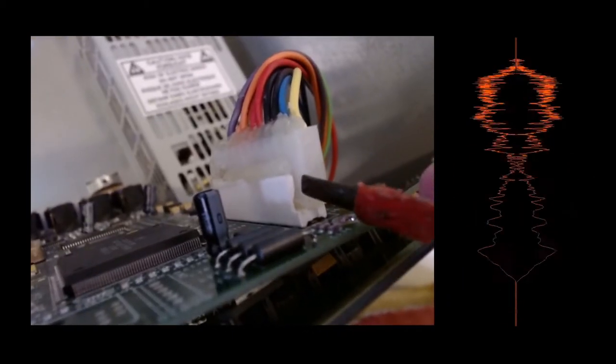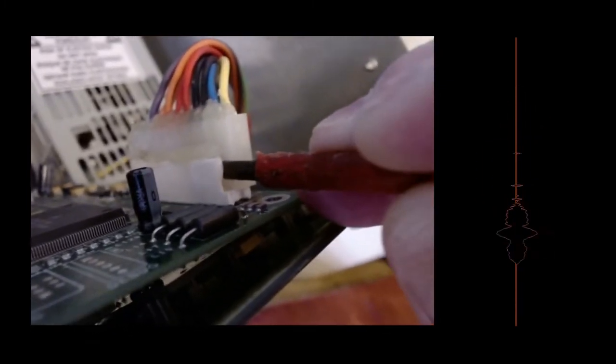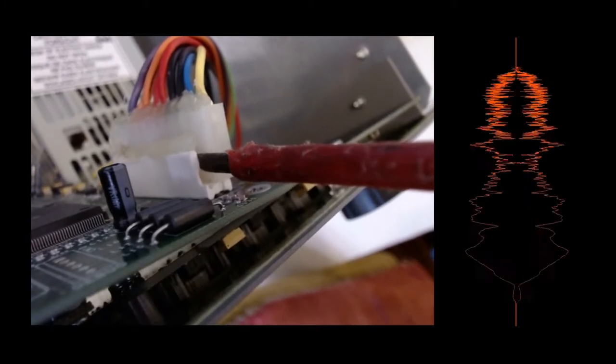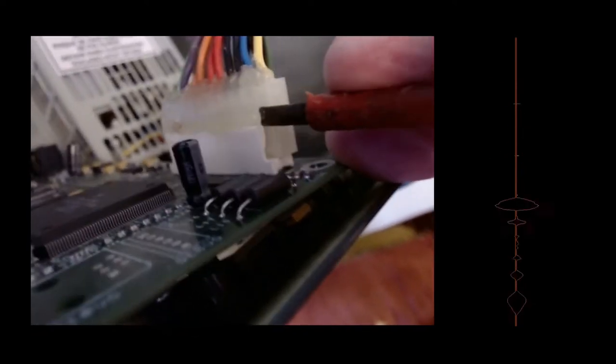Okay, yeah. Just in case it helps, I'm not sure if this glue is put on at the factory or if it's just someone else who's done it. So if it is factory wise, because I've only ever seen one of these units, this one, then the way I got the glue to start coming off is just by, with the screwdriver, down that gap there, gently twisting open, and then the glue started to come off the nylon, and then you can twist that off slowly. So if you work along carefully all the way to the end, that should be fine.